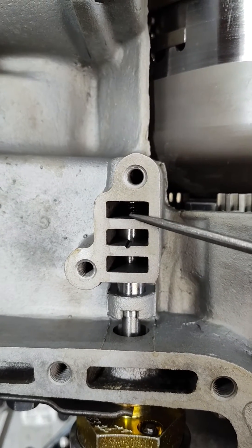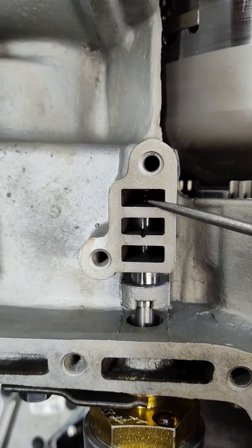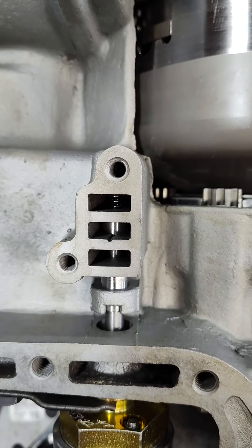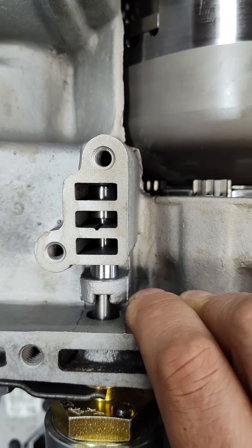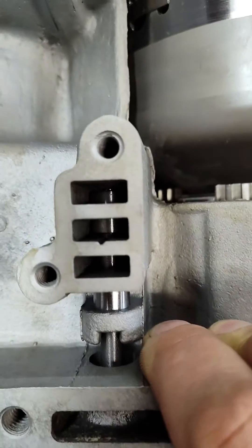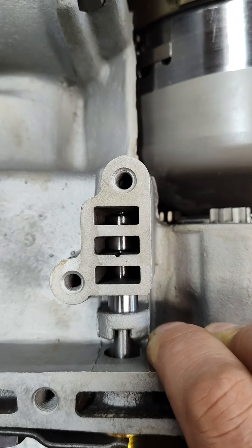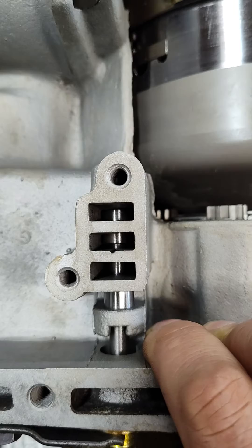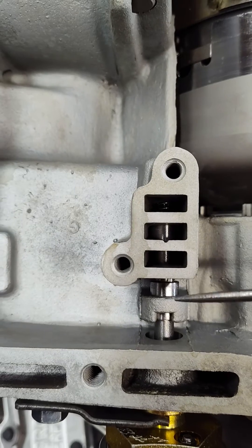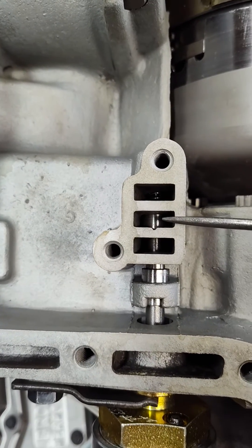The spring is in this window, and the spring goes inside the hole that's drilled in the valve, so that goes in like that. Now if we look at this second window here — I'm gonna push the plunger in — I want you to see how that opens in. We're closed off out here, which is good. This is trans brake on now. You can see how that opens up into there nicely.